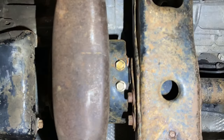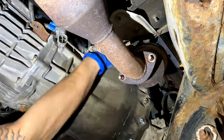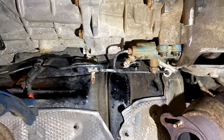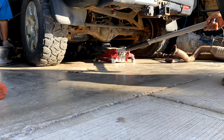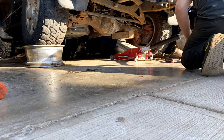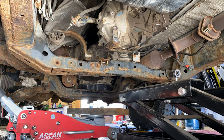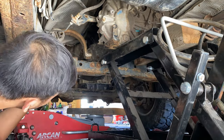Let's start with the drive shaft — remove the exhaust heat shield and a couple of brackets, then remove the exhaust Y-pipe. Also remove the front drive shaft, then remove the slave cylinder — be careful with those lines, they're pretty skinny and can break easily. Remove the bell housing bolts. At this point, we lift the vehicle up to get more room. A transmission adapter for a floor jack didn't work well because I couldn't raise the vehicle enough, but a motorcycle or ATV floor jack works well.